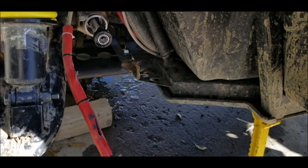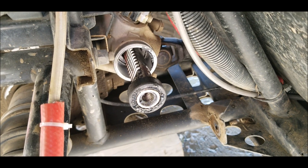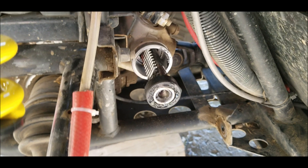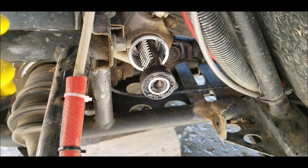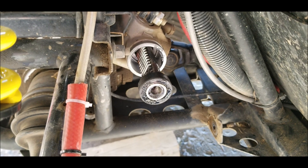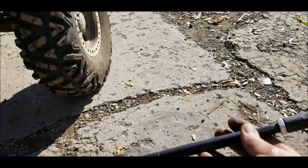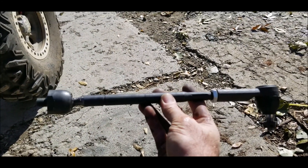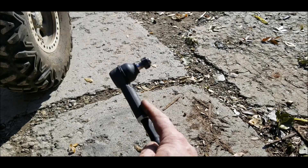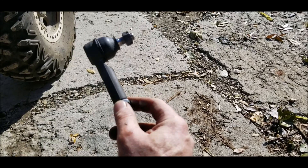The thread pattern on the rack is M14 by 1.5. I did some research, measured out my tie rod end, got on Moog's website, and found the part is an EV303 — I'll put the link in the description. The EV303 comes off a Toyota RAV4, as well as several other vehicles — it's a very common and cheap part. I got on Rock Auto and got these for $6 each plus shipping, so I was in it $15 shipped to my door. For the outer tie rod ends, also off the Toyota RAV4, I could have gotten those for $15 for the pair shipped, but I went to CarQuest and paid $17 each.